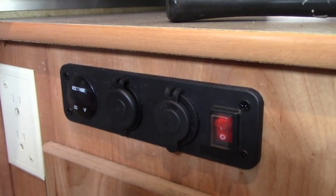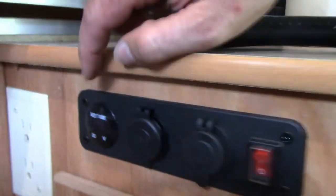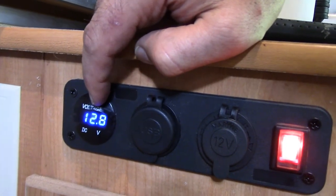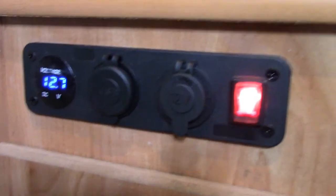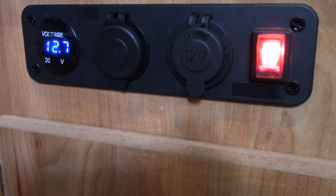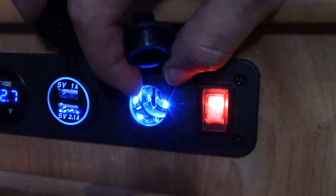Here's another little upgrade I did to my pop-up tent trailer — this is a USB charging station, 12 volt power outlet, and a battery meter, all right here. This will tell me what my battery voltage is at; it's hovering between 12.7 and 12.8 right now — we don't have a lot of sun, it's getting cloudy. This lets me manage my battery; if I notice it's going to drop below 12 volts, I'll stop using the 12 volt power. When I'm on a site with access to power, I can use this to charge up my USB devices and run other things.